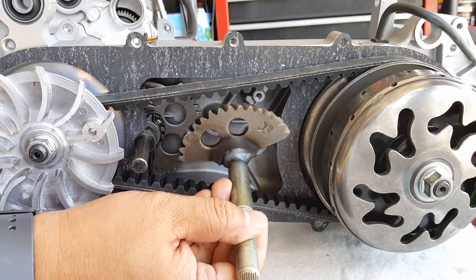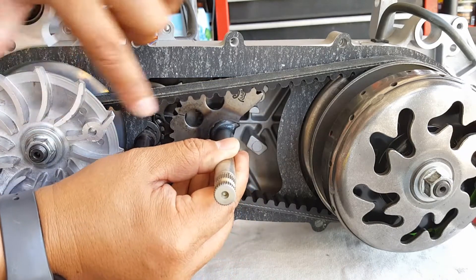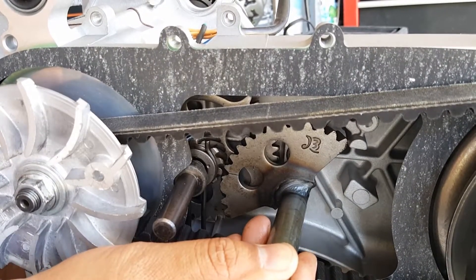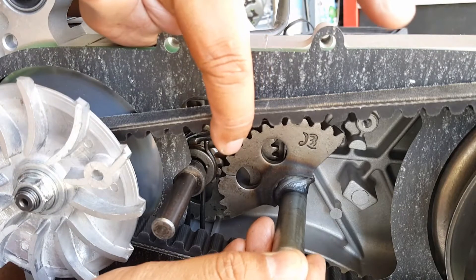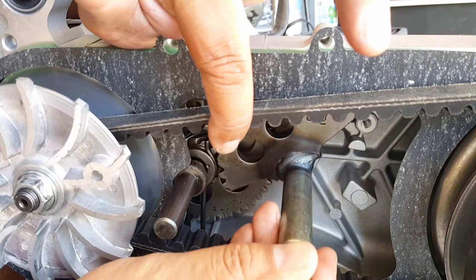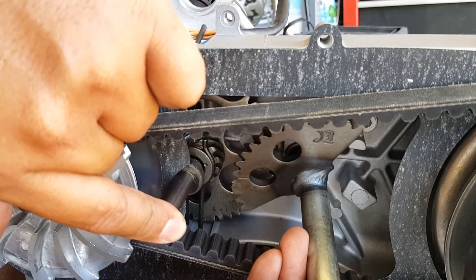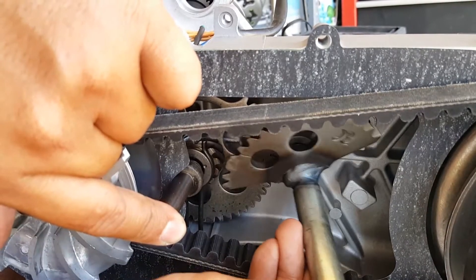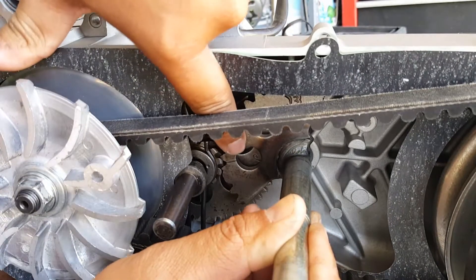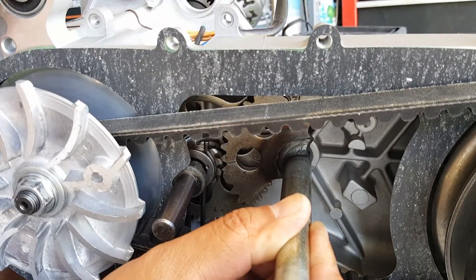We're going to put it in — it already has some grease in there. This is going to align with the teeth area. Once we get into the right groove, we'll have to wiggle it a little bit. It's not going to be perfectly horizontal but you want it facing as horizontal as possible into the indent. I had to go a little bit further down but it's still pointing almost to the circle indent mark, which is fine. It's good that we secured our CVT gasket so it won't interfere.